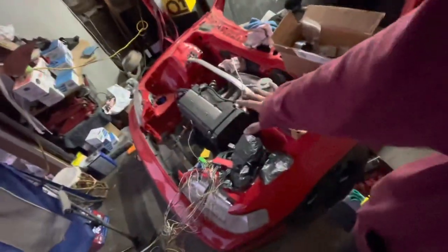The last wire is the black/white stripe — another 12-volt switch. I was confused about why there are two 12-volt switches, but this one goes directly to your alternator and tells it to turn on and start charging. It was also going to the blue plug to distribute power to all the automatic transmission solenoids — but since we deleted those, I'm going to cut them, splice them together, and run a solid wire straight to the ignition switch. That leads me to something else I learned: Honda has two ground wires.